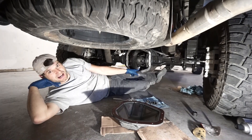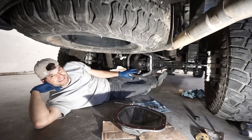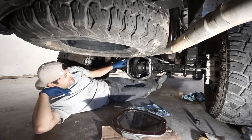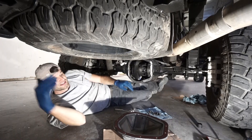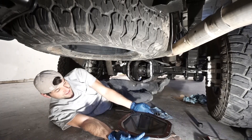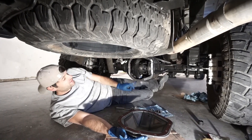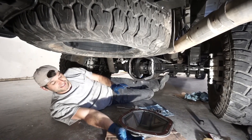Before reassembly, there are little pockets and valleys inside the differential that hold fluid — use blue shop towels and get those cleaned out anywhere that could be holding old fluid or contaminants. Use the wire wheel around the outside, a little sandpaper for any burrs, parts cleaner, then set the differential gasket on and put the cover back up. Get the bolts tightened — they really just need to be snugged up, but you can torque them as well. Then we'll add fluid using those new squishy containers.